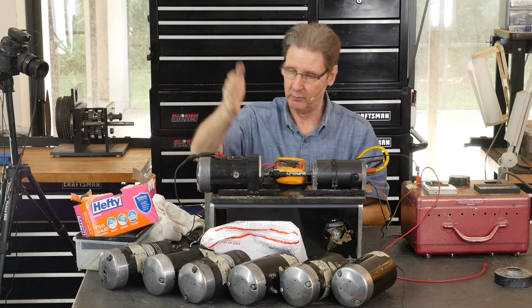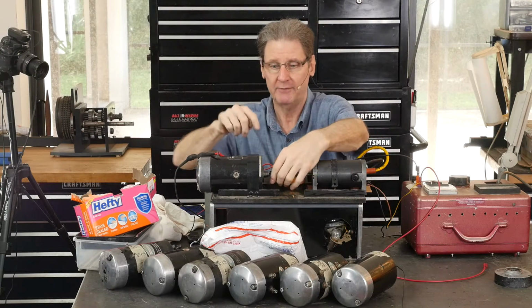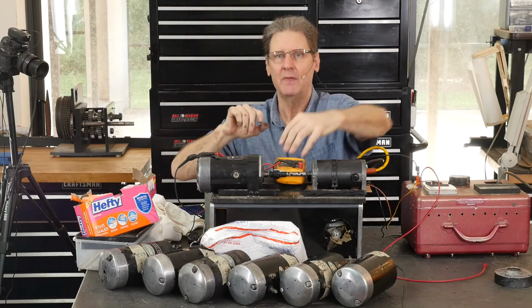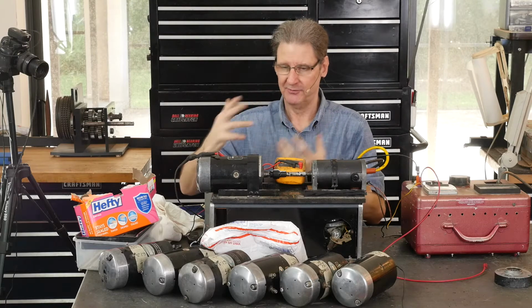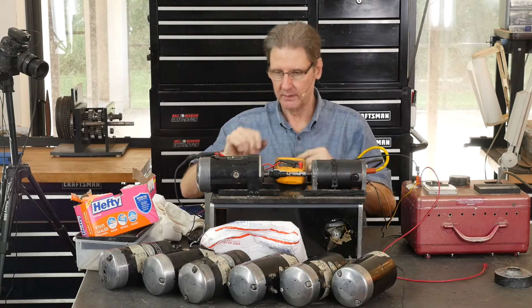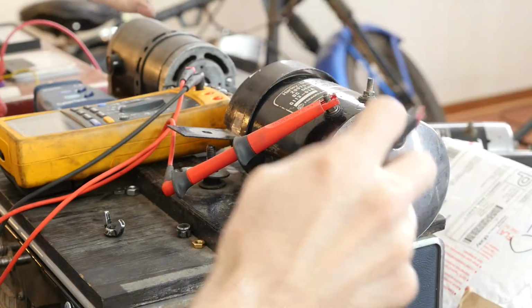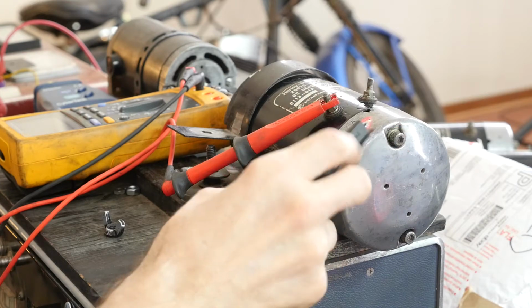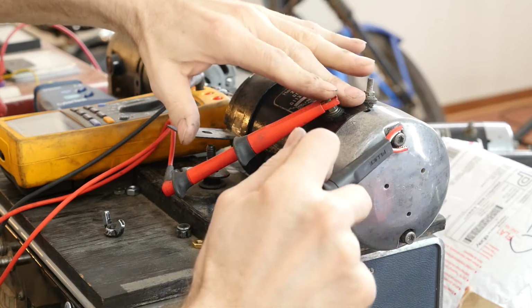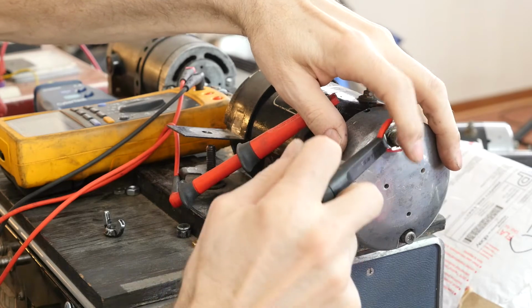And like I've said with the other ones, the armature is what usually fails. This one, I have a note, it's stiff, it makes noise, it just doesn't feel like the other ones, and it'll barely motor. Let's show you that. Oh no, before we show you that, here's another test I half invented. Let's just come here and look directly at the resistance of the armature.